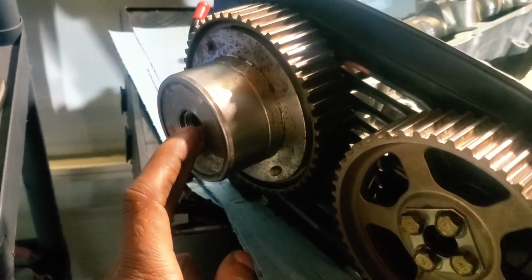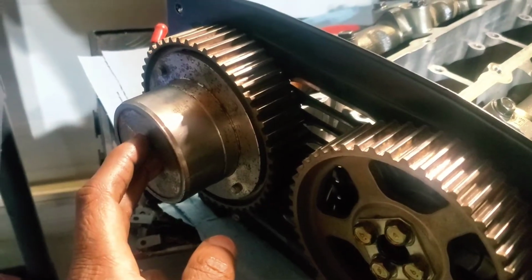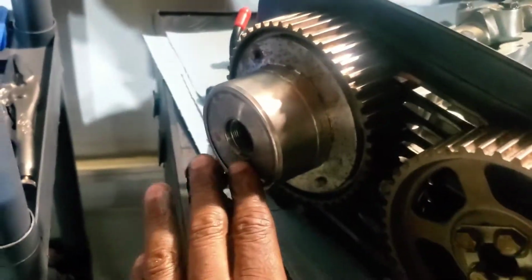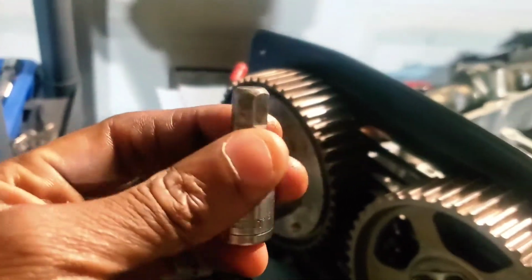So I'm gonna torque it in sections. I'm gonna start with 50 or 60-ish, and then I'm gonna go to 80, and then I'm gonna go to 90. And once I hit 90, I'm stopping. 90 is on the low end of the torque spec, by the way. So if it snaps, you'll see it here, and you know not to do it there. But what I'm using for that one is a 3/8 bit. So let's get that one taken care of.